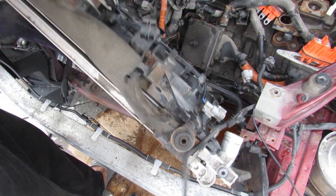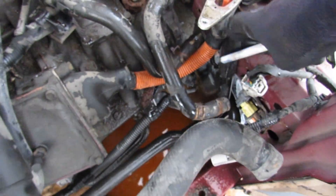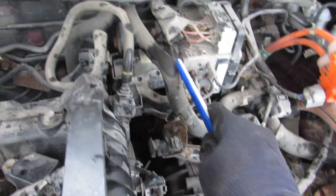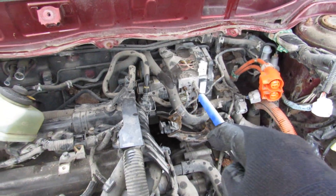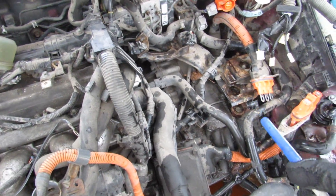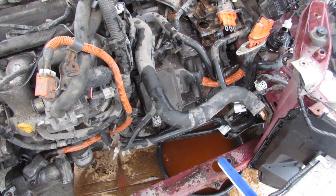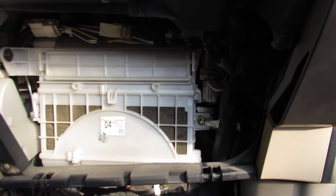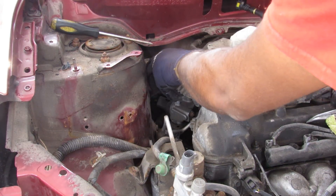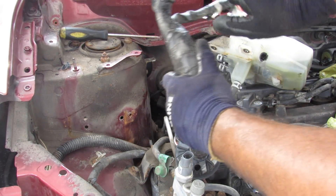There are some wires to disconnect before I can fully lift it out — and of course it's going to make a mess. With the condenser-radiator out of the way, it clears up the front half of the engine, but there's even more plumbing going to the water pump and the heater core. To lift the engine out I'll have to remove the bracket holding the brake actuator. However if I drop the subframe, I can leave the engine on the ground, pick up the whole car, and pull the engine out. Disconnecting the fuel connection — just squeeze the two tabs and release. Coming up under the glove box, there's a bunch of wires connecting to the ECU which I'm going to disconnect, and from inside the engine bay I can remove the grommet and pull the wires through, so I don't have to disconnect the wiring harness from the engine when I pull it.